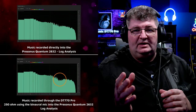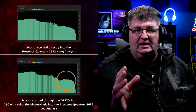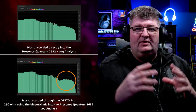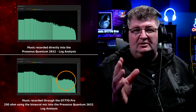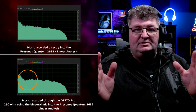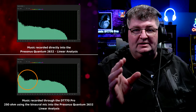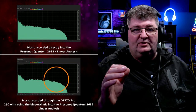The log music comparison again shows that dip in the 3.5k area and the boost above that, and you certainly can hear it in playback. There's a certain kind of high-end crispness that I hear on these headphones — it's a little subjective, which is why we do the log comparison. On the linear comparison we can again see that 3.5k dip. Keep in mind the linear analysis spreads everything out for more detail in the upper frequencies, so that dip looks wider than it actually is. But above 10k we can see that bump again with a little more emphasis in those frequencies.